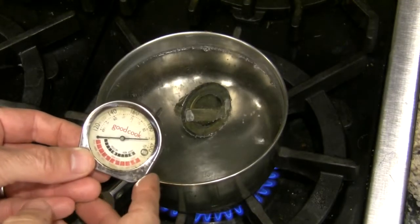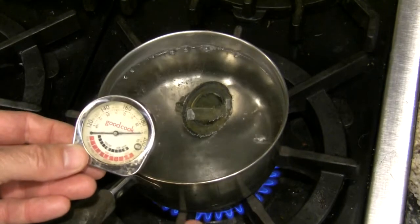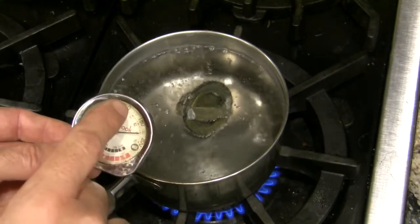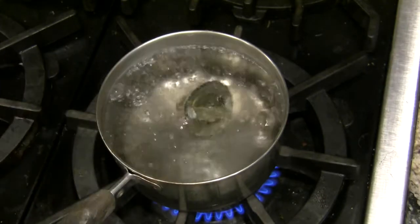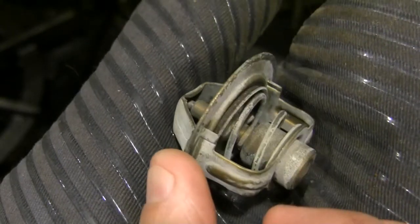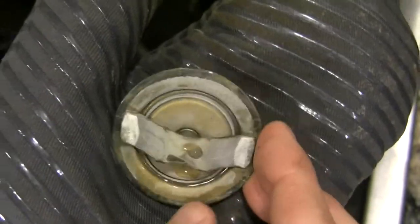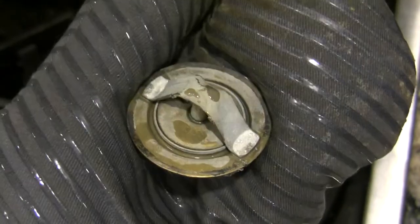Coolant would be flowing in your engine, going through the radiator and cooling it. That's not happening here — I'm just continuing to put heat to the water, which means it's just going to boil. But in your engine it would be cooling now and should stay around that 180-degree mark, maybe hovering up and down a little. There it is, open — and as it's cooling it's closing up. Very simple design; they've been this way for maybe a hundred years, and still the way it's done in automotive and motorcycles today.